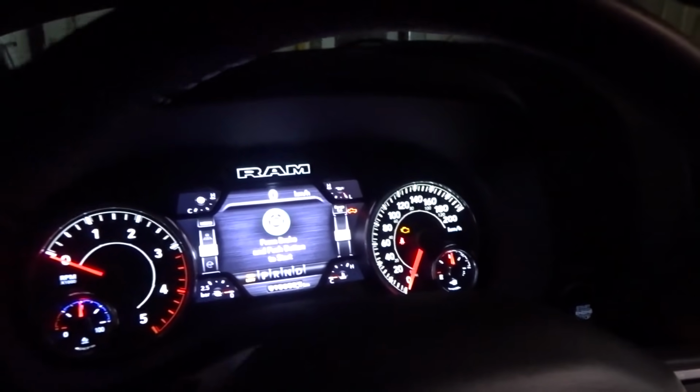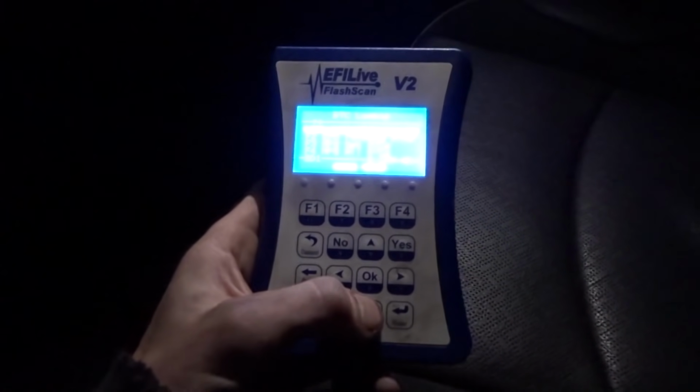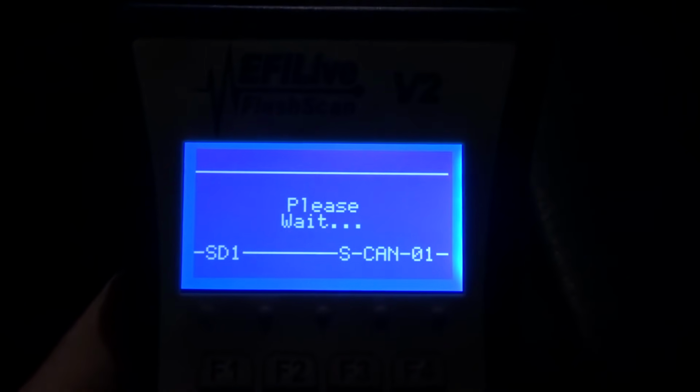Alright, I think I got the throttle valve figured out. Just gonna unplug it right now. I already got the clips and stuff off of it here, so we didn't have any time wasted. Alright, throttle valve unplugged. Sometimes it throws a big red lightning bolt on the dash if it gets unhappy about that, but looks like we're good so far. Okay, let's check it on here. Oh, no DTCs. What about if we start it?